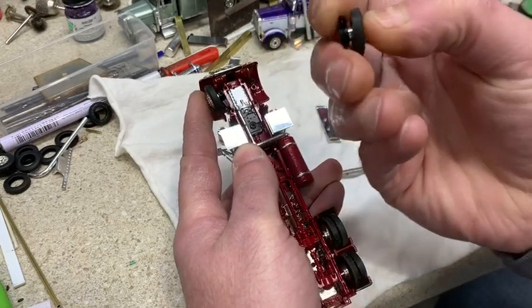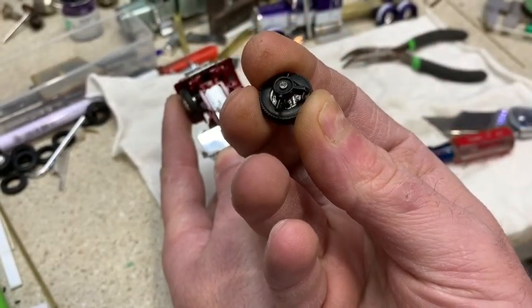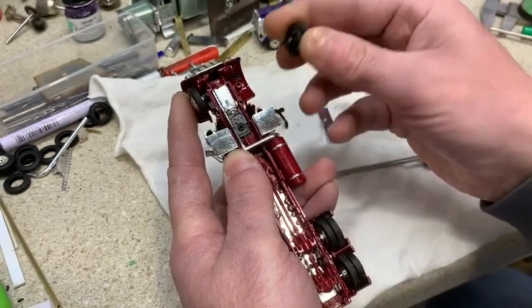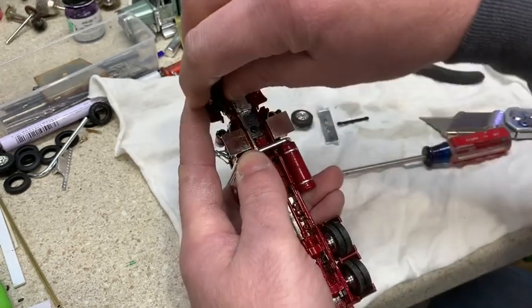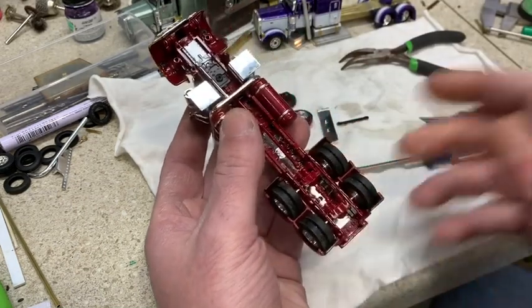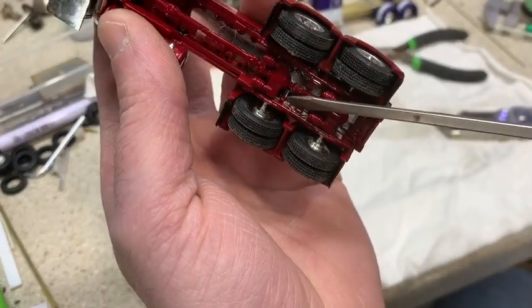Now, on these spindles, they have a small tit on top and a larger tit on the bottom. When you go to lower a truck, you're going to take the passenger side, put on the driver's side, and the driver's side, put on the passenger side. So as we've got this apart, I will go ahead and show you the rear before we start assembling the front back.